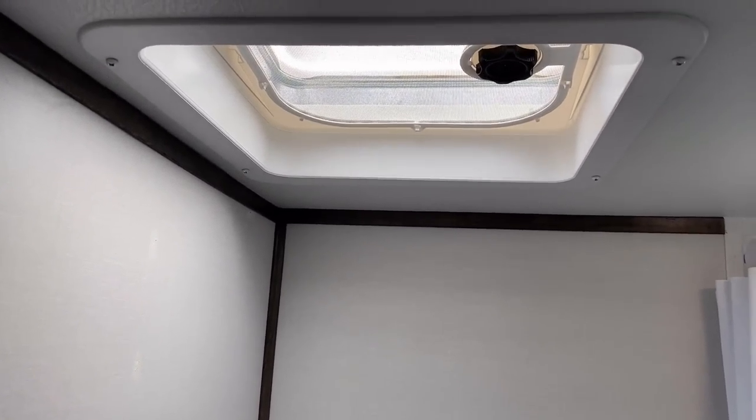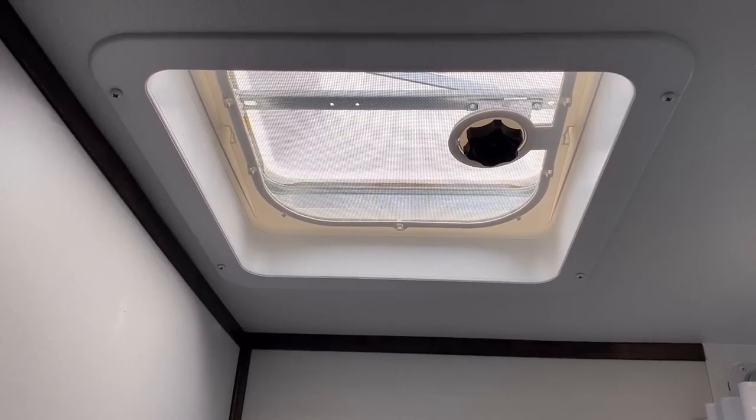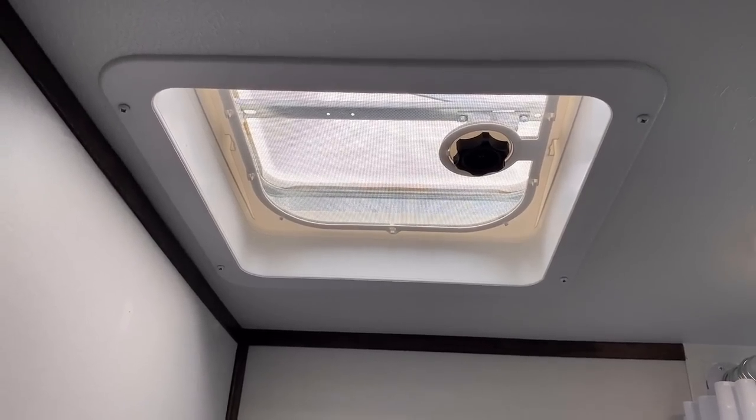It's a vent, but it's not a vent fan. I don't understand — I have a recommendation to work around this though. There's a fairly easy workaround if you want a powered vent fan: look up the company Hengs — H-E-N-G-S. I'm not sponsored by them, I just really like their product. It's a full-size, high exhaust flow vent fan. Because there's a ceiling light right next to the vent, we could piggyback the 12-volt power off that and put a vent fan up in there where, I think most of us agree, there probably should have been something to begin with.